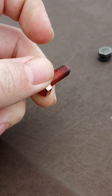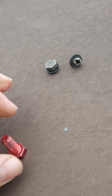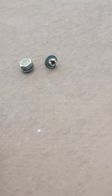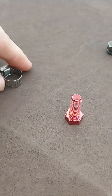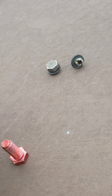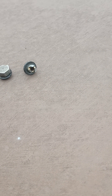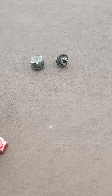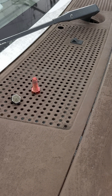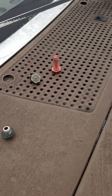So what I'm going to do is drill this out and turn it into a banjo bolt by simply taking a drill and drilling right through the center, and then drilling some holes on the inside and getting everything perfectly lined up. I'm going to take this clamp and put the two pieces right in there so it'll hold them lined up so I can make sure I get the drill bit in the correct location.